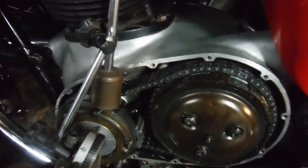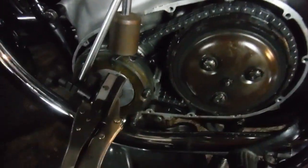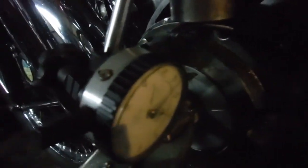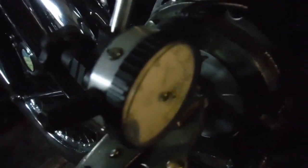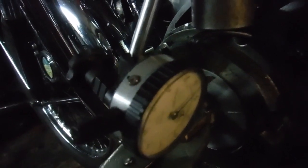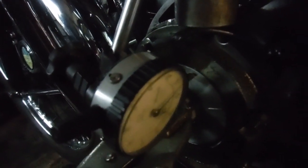We'll make a few checks like that and then see whether we're going to be stripping the engine down, and if so, how far. We'll have to go into it deeper to see what we've got on the timing side. That end float, like I say, is excessive really — even though it's not much over the maximum compared to some. Further investigation needed.